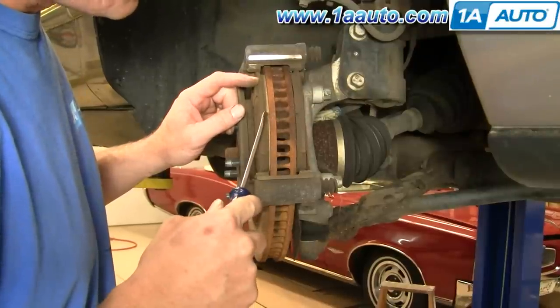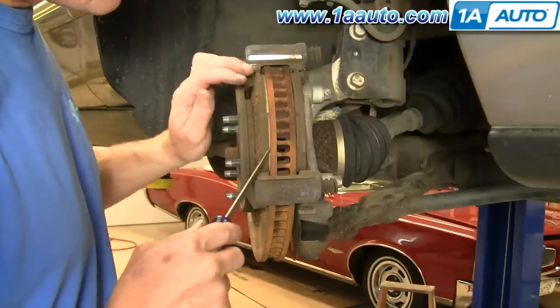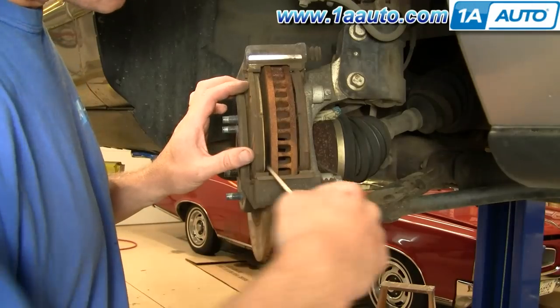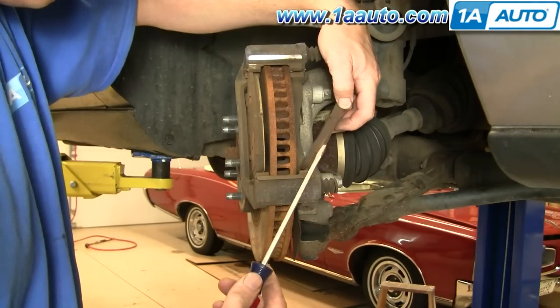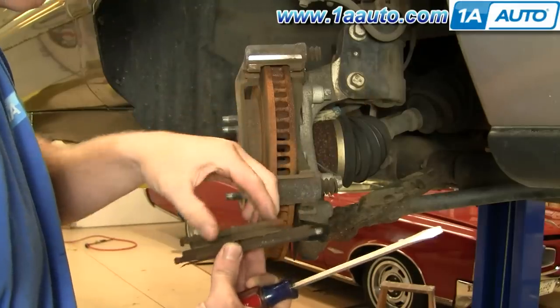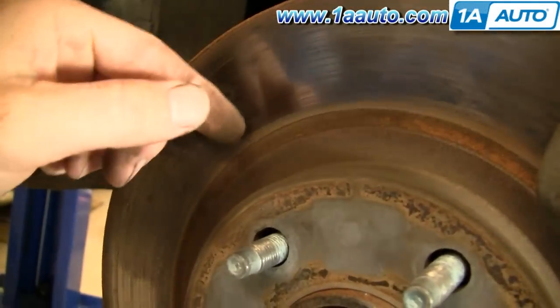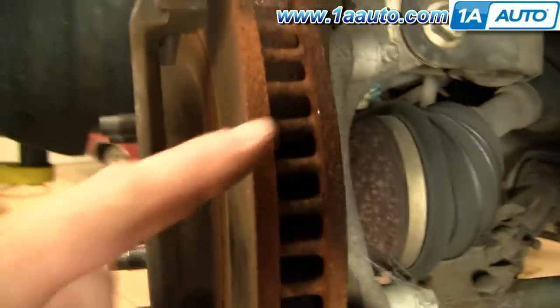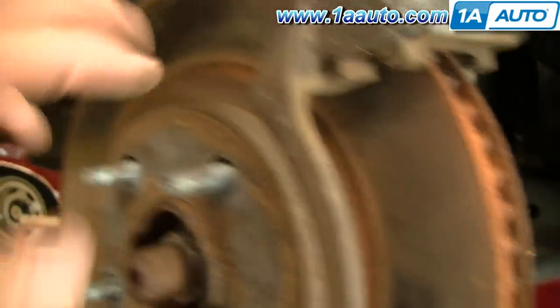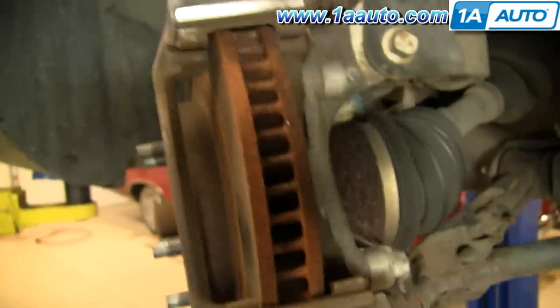So there's our inner pad and our outer pad, and you can see the wear mark there. They still have some good life on them — not a ton of miles, but definitely don't need to replace them yet. But if you did want to replace them, you can just pull your pads right out. Now your rotors — on most vehicles, what you want to do is take the back of your fingernail, kind of run along the rotor, feel for any deep grooves or gouges, and then inspect the condition of the rotors. These look absolutely fine. If you feel any grooves, or there's too much rust or corrosion, or your rotors look thin, then you do want to replace them.